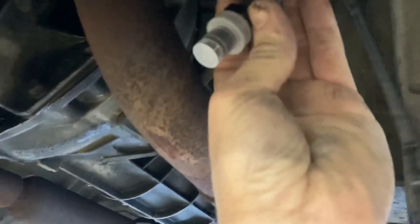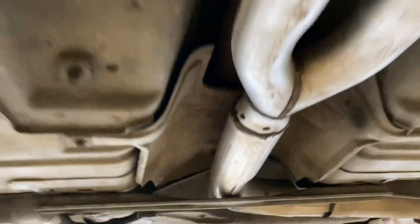I'm putting the wideband bung on it. I'm going to try to put it here — you've got to get it at an upward angle. If you have it angled downward anywhere it can collect water. Here's a look from below at the exhaust I have on it. It does have two mufflers but it's super loud still anyway.